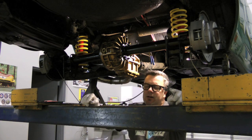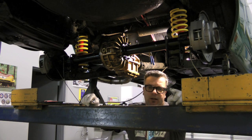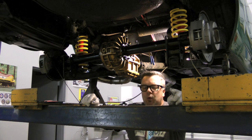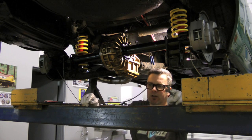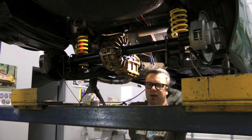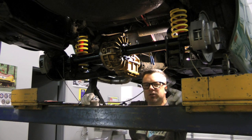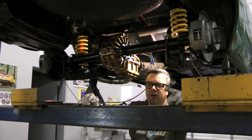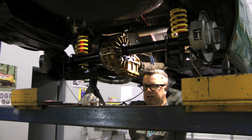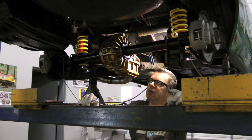The 410 has a much lower RPM drop on the highway than a 456. So if you're going to change out the differential in your car for a limited slip, you really need to consider what the application is going to be. For mostly city driving and back roads, you might enjoy a 456. For mostly high-speed highway driving, consider a 410. If you're somewhere in between, try to get a 430. They're not that hard to find but you do pay a premium.